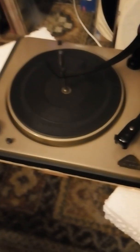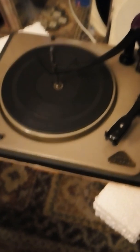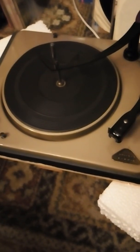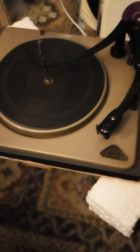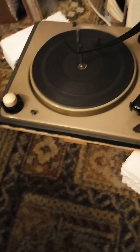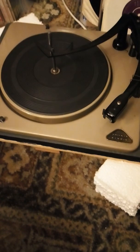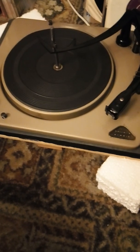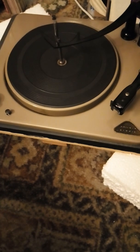So this thing was all seized up — all the old grease, the brown grease, had solidified. Had to scrape it off and use WD-40. It's an oil — re-oiled all the parts. I've got some special oil used for clocks, since I used to restore clocks. I use clock oil because it's very light, or you can use lithium grease, just as good.